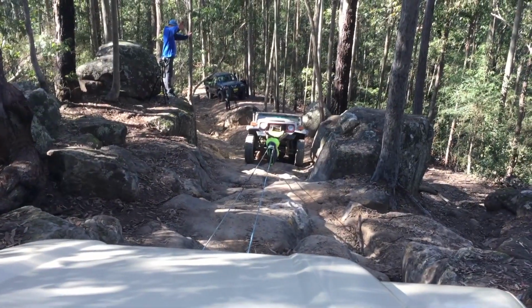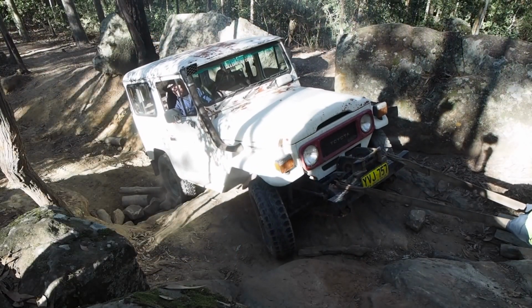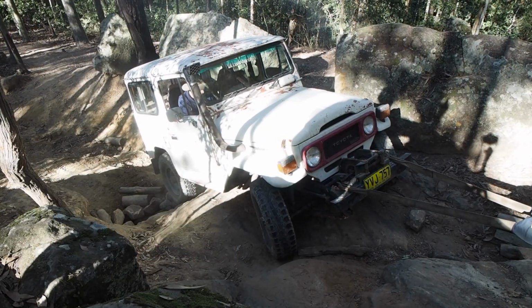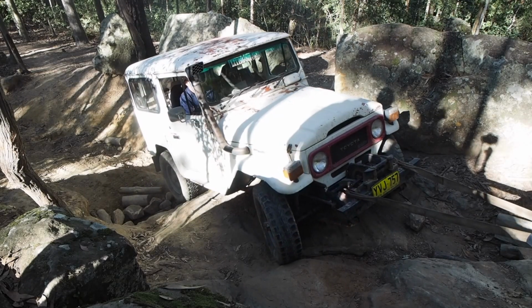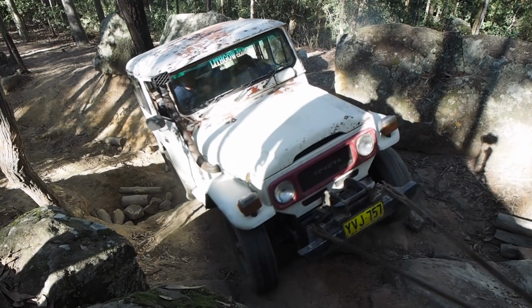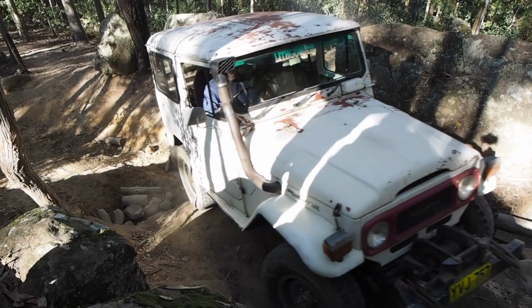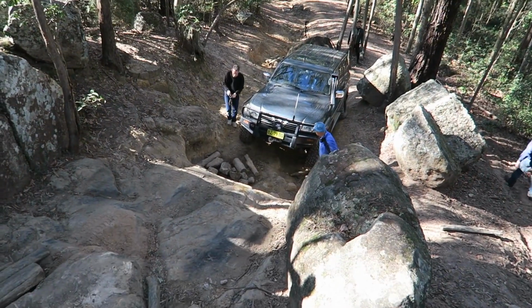As I was in front of Rob, I turned around Tiny and we winched Rob up with a double line pull with the Tiny. In comparison to the steel cable on Rob's winch, I used Dyneema rope, which hardly stores any kinetic energy and pretty much just drops to the ground if it fails.